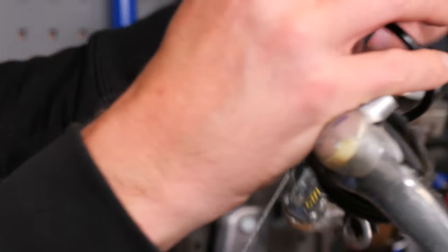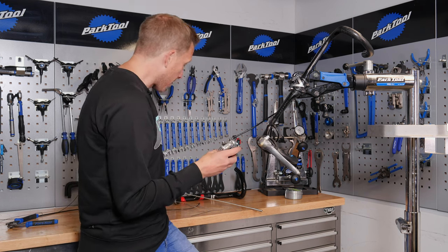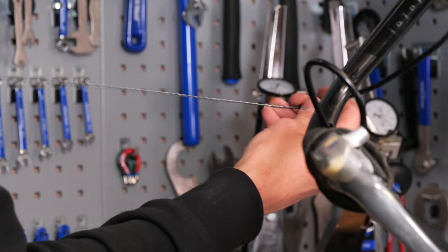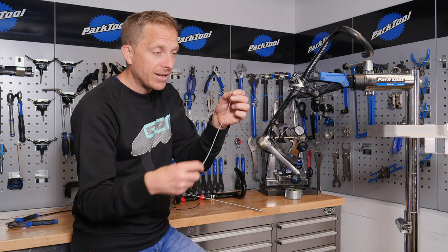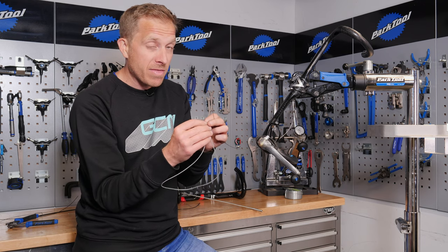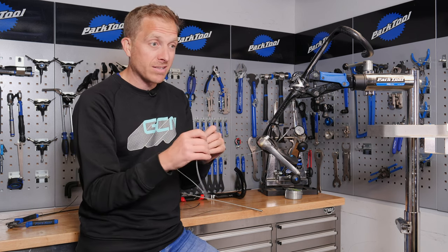What we're gonna do: because if we take out this inner cable, you're not gonna be able to replace it easily — you've gotta try and find those tiny entry and exit holes at either end of the frame. So we're gonna undo the clamp cable of the component, lose the component or keep it in place on the bike, remove the last bit of cable out the back, and reveal the inner cable. This is where a little bit of cable sheathing comes in handy. Pop down to your local bike shop — it's available for both gear and brake inners. A gear inner is a little bit thinner in diameter, and that's not gonna fit over brakes, so make sure you get the right stuff. If in doubt, just get the brake sheathing because that will do both.